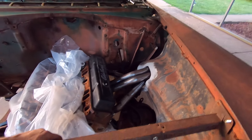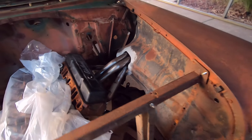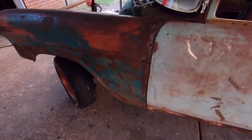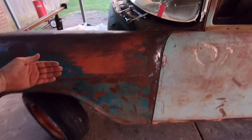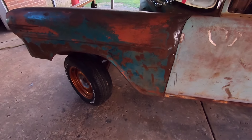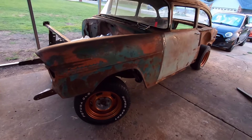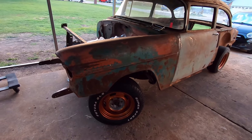This will actually adjust. I've got more welding to do - I'll have to go back and remove the self-drillers and weld all these, then grind those, but it's going to work. I'm really happy with that. That old fender - I mean, it's rough, but once it's blasted and I do a little hammer and dolly on it, it'll look pretty good. I'm happy with that flange - it looks pretty sick. I guess I didn't really take two full days on that flange because I did all this other work too. Anyway guys, that's it - two days I put into this thing, and that's why I never get as far as I want because of all the trying to get everything to line up where it pleases me. Thanks for watching.